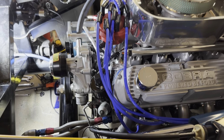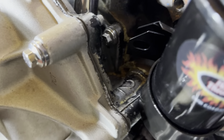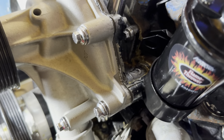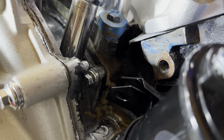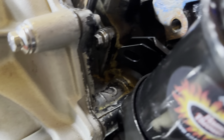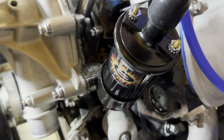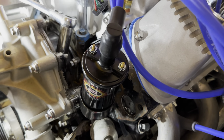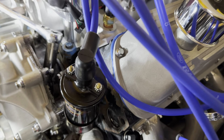On to the next — messing around with the coil and this bracket I got. I bought it off Amazon, labeled as a bracket for a Ford F-150 or Mustang. It's going to work. There's a hole right there in the cylinder head — I measured the depth so I know what bolts I need — and I can use that hole with this bracket to have the coil mounted right there. The line's long enough, so I'll just need to extend the wires off the EFI harness.